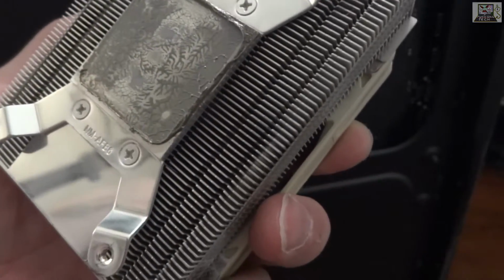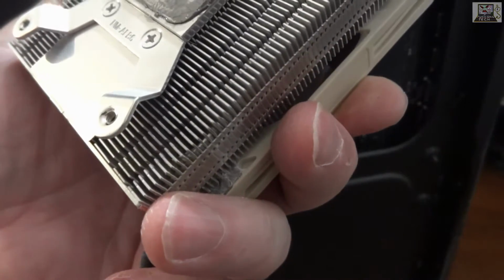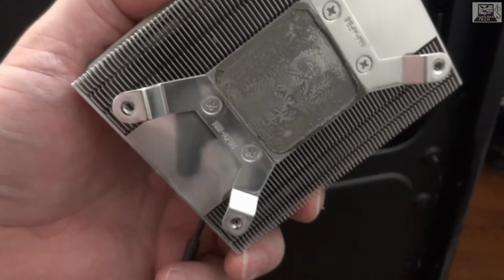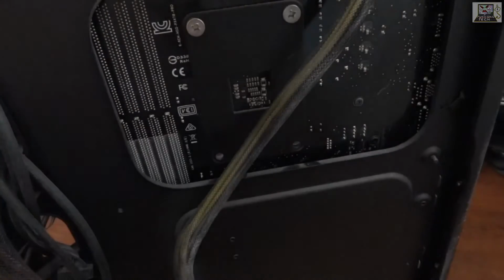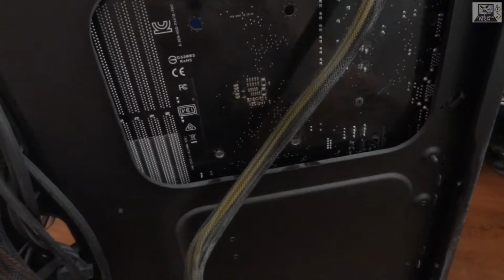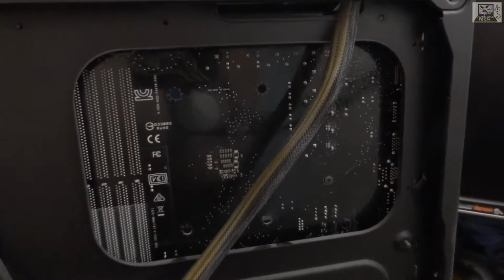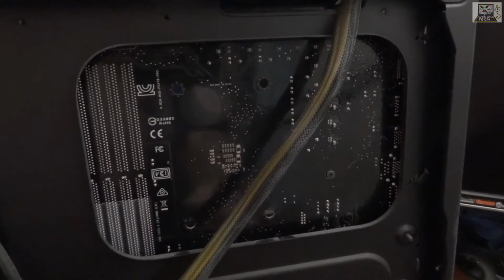The Stealth Wraith that came with the processor was good enough, but I decided to use this because apparently it was a little bit cooler than the AMD Wraith cooler that comes with the 1700. So, all right, I had applied proper thermal paste with this, with the spudger. I spread it all around, so I'm gonna take away this Noctua fan. And what's next? Okay, we're gonna remove this back plate. Here we go. All right. Remove this back plate and put the standard stock AMD back plate.